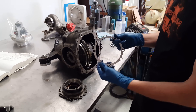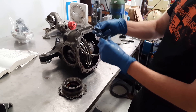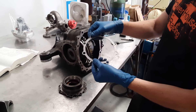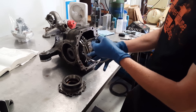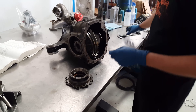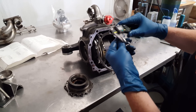So what Powerhouse has done is we have what's called a peel-away shim. The way this works is it's basically about 40 different layers of steel, each layer about two thousandths of an inch thick. So the way this works is you basically start at a thickness that's a little bit bigger.